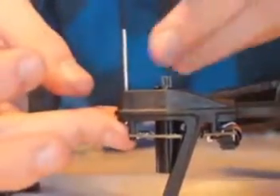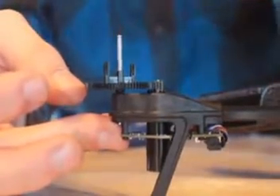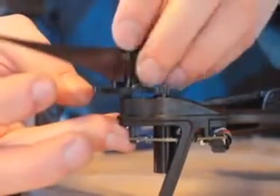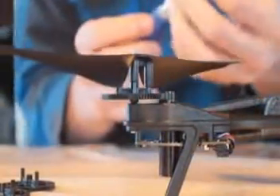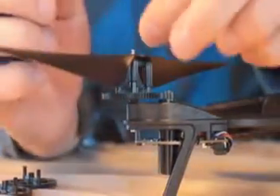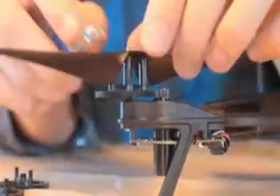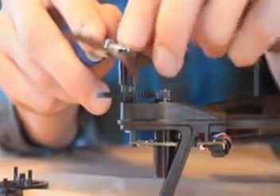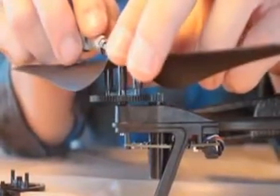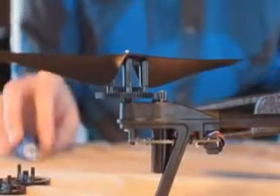You're pretty much done — do this on all four. Push the shaft in, put the gear in. The propellers need to be in a C, A, A, C pattern starting from the top left — they're marked with the letters on there. C on top left and bottom right; A on top right and bottom left. Put your C clip back on. Switch bits to the blue screwdriver. Once you've got that on, just pull up and spin around to make sure all your teeth are in place on the gears properly. Thanks for watching — subscribe or like this video if it was helpful.